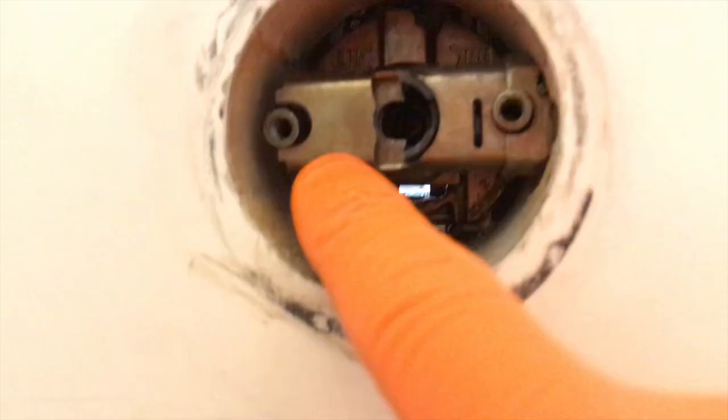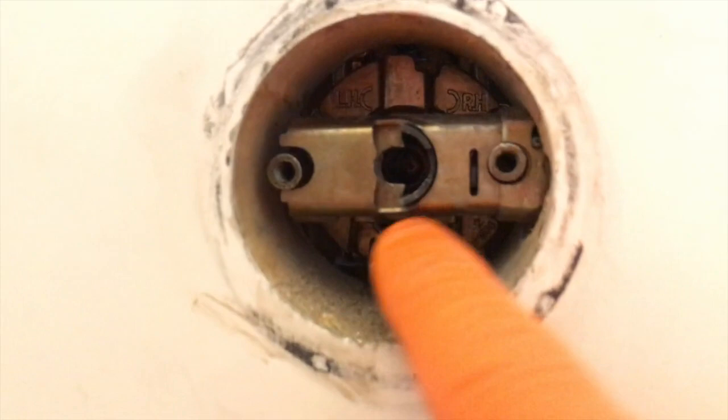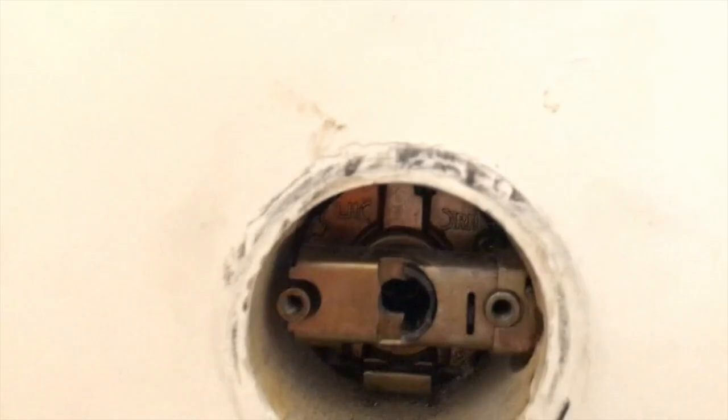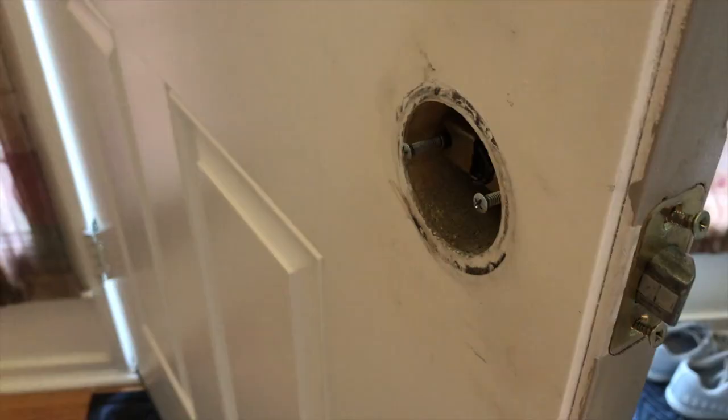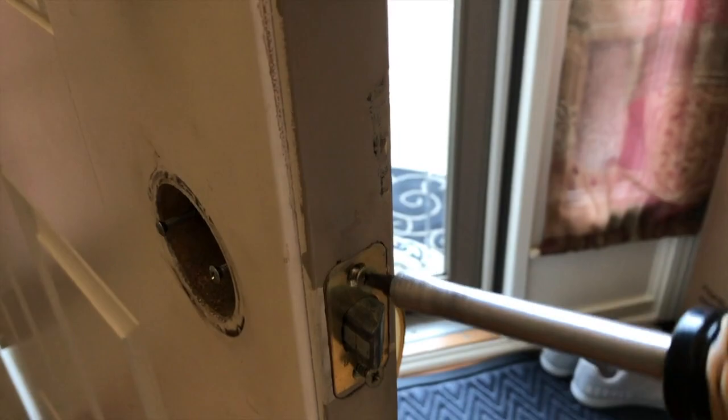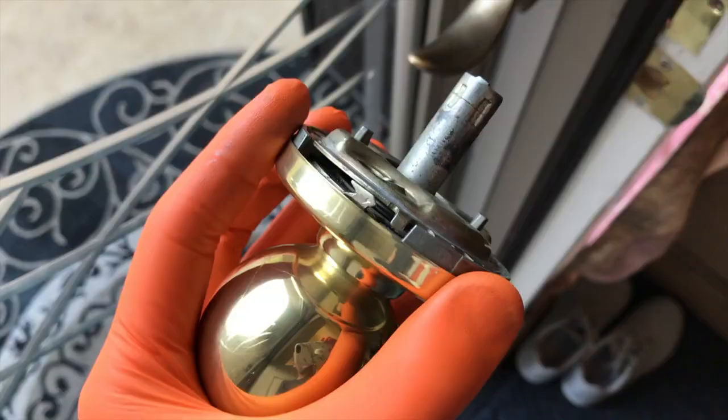You can take out this part to get better access to the screws — one on the bottom left, one on the top right. Make sure the parts are properly lined up, this little piece is through its circular slot, and your exterior panel is flush with the door. Now re-secure these long screws inside the holes. Do your best not to cross-thread these. At this point both Phillips screws are screwed in and just a hair above the actual flush portion. Now come to the side and re-secure these Phillips screws.